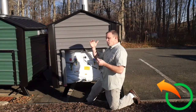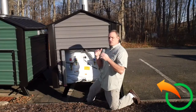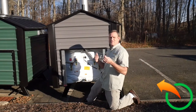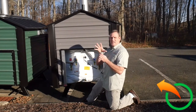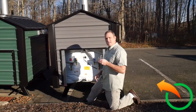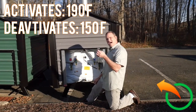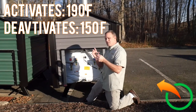It won't turn back on the fans until this temperature probe snap disc reads 150 or even maybe 140 degrees. So before you start worrying, let the stove cool down to about 130, 135, 140 degrees, and then this should reactivate, open up, and the fans will turn back on. It's just a safety system — it activates at 190 and deactivates at 150 degrees or so. It's spring-activated, so it might be a little less.